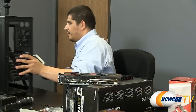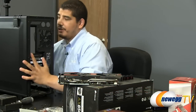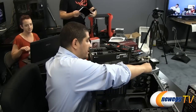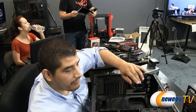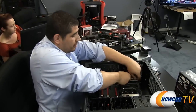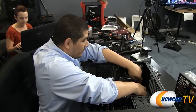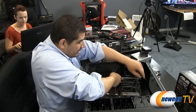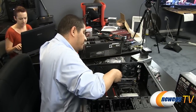First world problems. How many volts can I run a 4670K at with a CM Hyper 412S? That's very specific. It is. I would say you're going to generally be in a comfortable zone. Now this depends on whether you're going to do an adaptive voltage or a manual voltage, because of course, as we talked about in our overclocking guide, with an adaptive voltage, the voltage will change under stress test applications. But assuming you're only going to measure your voltage under real world usage, so games, web browsing, general productivity applications, things along those lines, I'd say you'd be able to comfortably dissipate up to about 1.225, possibly even about 1.25 volts.